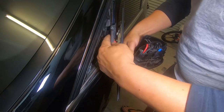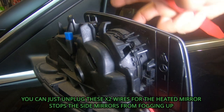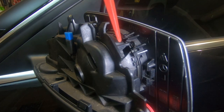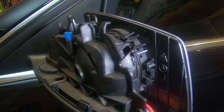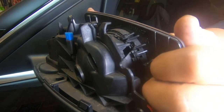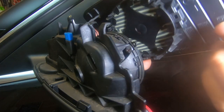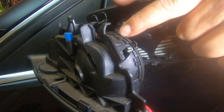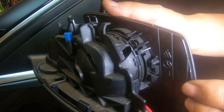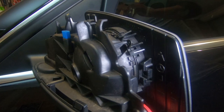Now I want to show you how to properly remove your side mirrors. If you look carefully at your side mirrors, you have two clips here which control the heating function so that your side mirrors don't fog up. I have seen many people simply pull it off with brute strength — I'm going to show you that you can do it, but I don't recommend it if you can help it. I truly believe that eventually these clips are going to get brittle and you're going to break them.